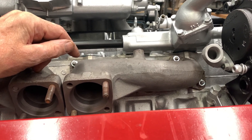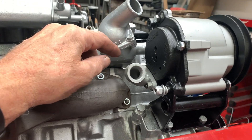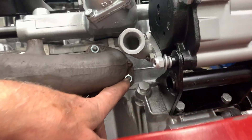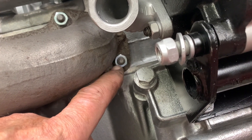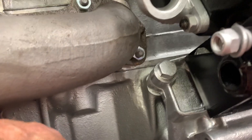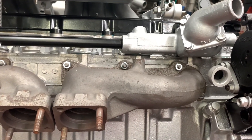Another thing I relearn occasionally: if you go ahead and put the air pump on first — I get kind of excited to see things hung on the front of the engine — that one right there is going to be really hard to get at. You're not going to be able to get a closed end of a combination wrench or a socket on it; you'll have to use the open end. If you've got that stuff on there, you're going to have to do an eighth turn, go up front, eighth turn, and so forth. It's not a big deal, but just giving you a heads up.